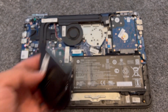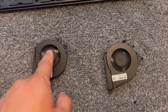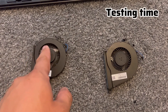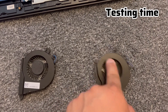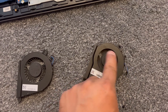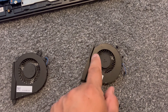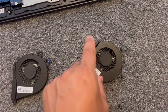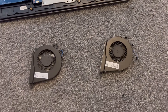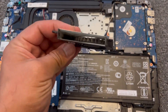I'm going to show you how to test the fans. So if you don't know, this is how you know which one is defective. As you can see, this one is spinning freely. This one is not — it's making a grinding noise, the bearing is gone, it makes it stiff, there's no lubricant in there. This one spins freely, this one does not. That's how you know, guys. So once you open up your laptop, you just test it like how I've done it.